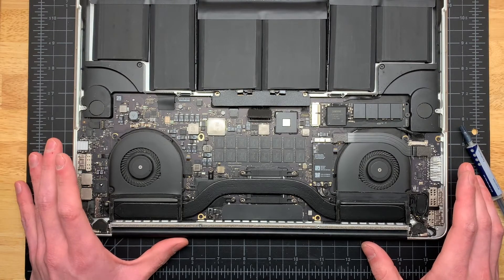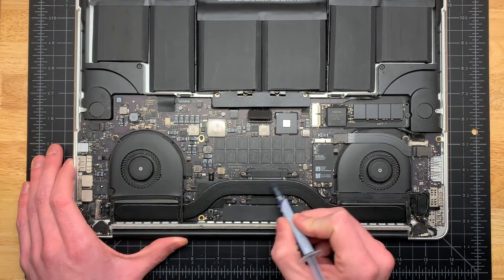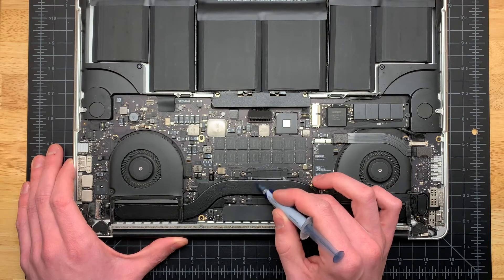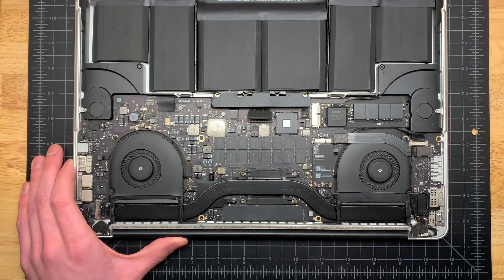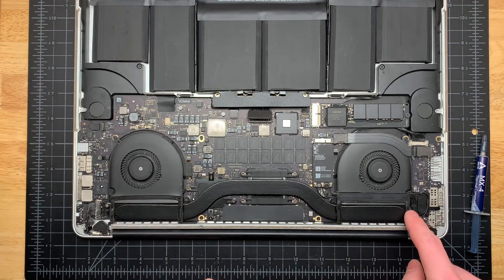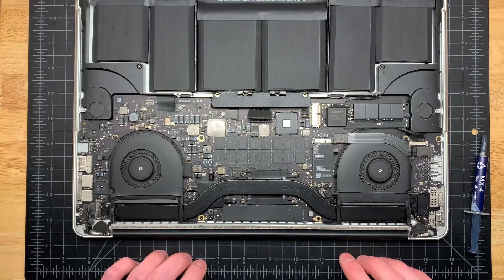You can't linger on negativity for too long, so let's move on. What I did: I took the thermal compound — there is the larger square and the smaller rectangle. I put a little bit in an X pattern on the CPU, a little more in a line on the rectangular one, and then a smaller X pattern on the GPU. They didn't turn out perfectly, so I did spread it around a bit and had to add a little more to the CPU side. When putting the heat sink back in, there are some connections it has to go underneath, so angle it in and then bring it down — it'll go in just like butter.